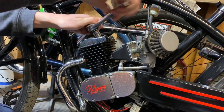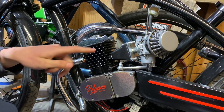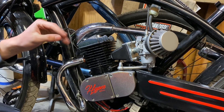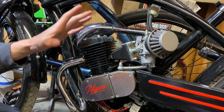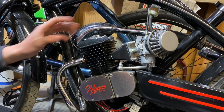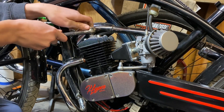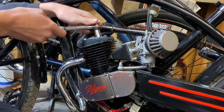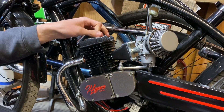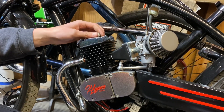It shouldn't be too tight. You don't want to over-tighten your cylinder head — I get a lot of questions about base gaskets or head gaskets leaking. You can over-tighten it and that will do the same thing: it's going to squish out the gasket material and not give you a good seal. You want 12 foot-pounds on these — that's the recommended torque spec. Go by that guideline and you won't have any issues. Also make sure all your gasket surfaces are prepped before you install a gasket — wipe it down with alcohol. I've used Windex before also; it's got ammonia in it and it actually works pretty well.